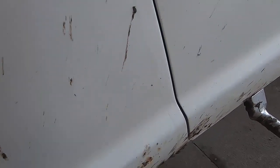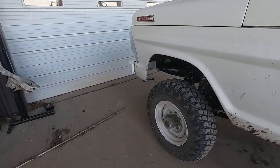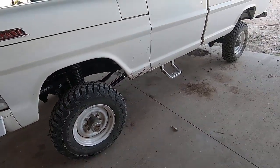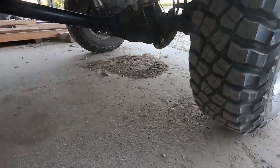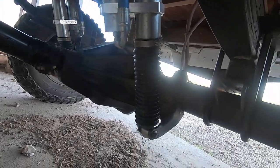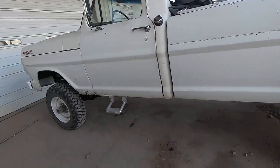Here's a chip from those tires — there's one, and there's one there on the side of the truck. It was also pretty noisy under the cab with all the rocks hitting under the bed. These KM3s throw a lot less rock — the rocks they do throw are smaller, like pea-size versus walnut-size, so that's a lot better. I also got the shocks on and put some shock boots on them for pretty much the same reason — on these gravel roads the shafts get eaten up. You can see that axle tube already has all the paint chipped off just from rocks being thrown.